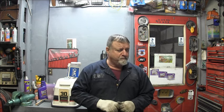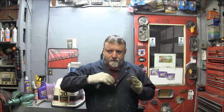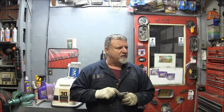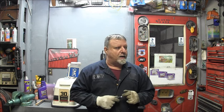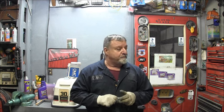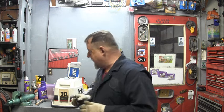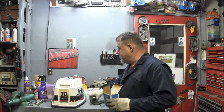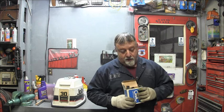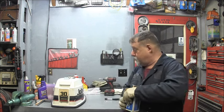Okay, so we've got this thing firing now, and I still need to pull the power pack off, route the wires in the best way I possibly can, and I've got other concerns. We removed the improvised manual choke off of here. I don't think the primer's going to be a problem. None of the plastics broke or anything, but we won't know until we try and spin her up. Okay, so we got this bad power pack. We got it off. I stick it in the box. I give it to the owner when he picks up the motor and say, there you go.